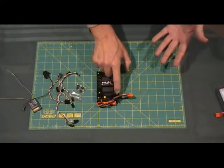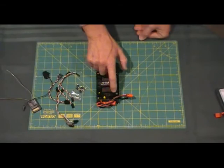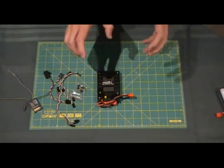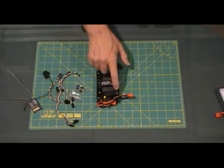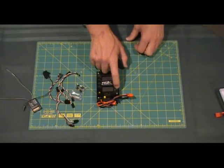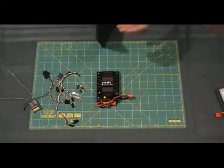The light — the idea of that little light there, which I probably never explained too much earlier — lets you know what the voltage is on your battery. Green means the voltage of your battery is okay; when it starts to flash it lets you know that the voltage is getting down a little bit; when it goes to red it's telling you that your CDI ignition voltage is getting a little bit low. The green LED, the little rectangular one, just tells you whether it's switched on or switched off.